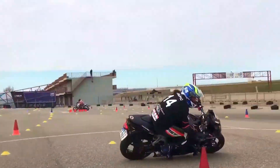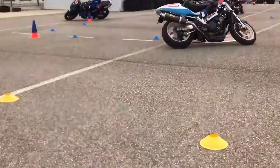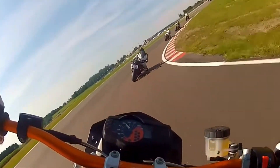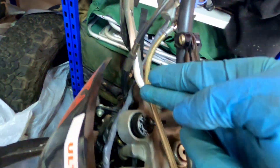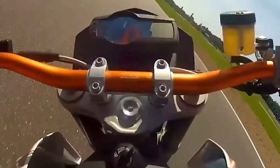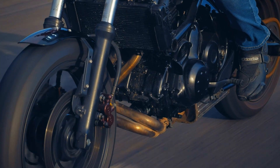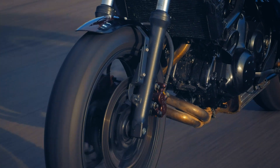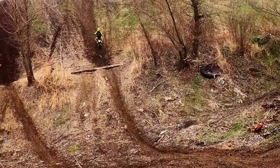Older anti-lock systems don't work very well at lower speeds, though modern ones are good even at slow speeds. For track riding, ABS is debatable. In addition to less weight, on a normal bike the brake line runs straight from the brake cylinder to the calipers — with additional lines to the module and back, you lose some feedback on the brake, though this only really matters for very high-level riders. On track there are also far fewer surprises than on the road, so braking is more predictable each lap. If you are planning to ride mostly on public roads, definitely pick a bike with ABS — the advantages are much bigger than the drawbacks. If you're planning to go off-road or do sporty stuff, it depends on your particular situation.